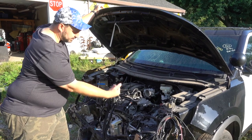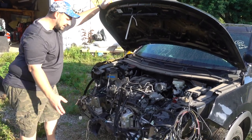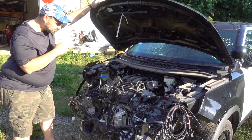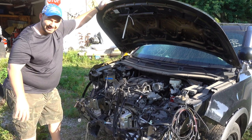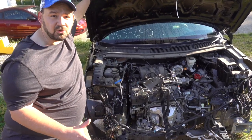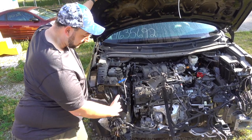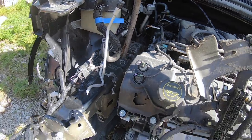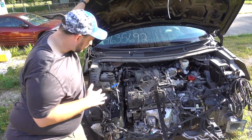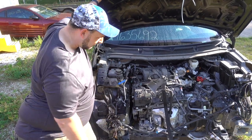They've removed the battery and battery tray over here, but there's really nothing else going on on this side. Over on the passenger side you can see there's no radiator, no condenser — that stuff was removed. There's an auxiliary oil cooler that is damaged so it's going to have to go. The passenger side took the brunt of the impact — this fender is pretty messed up, the bracket in the front is pretty gnarly, and the frame rail is bent and pulled. I've got a buddy who does framework and body work, and he's confident he can fix it — we'll try to pull it, but we may have to section it out and weld in a replacement.